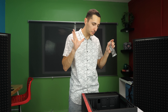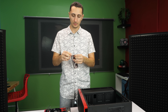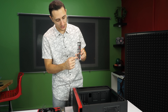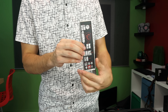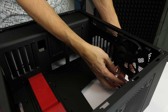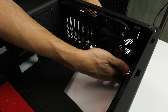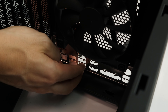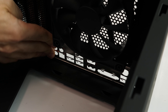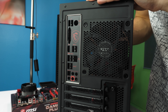Now the motherboard is ready to be placed inside the case, but before we do that we've got to pop in the I/O shield. Take it out of the motherboard box, peel it open, and make sure the circles are facing the downward position. Position the metal portion outwards from the inside. Apply pressure on all four corners evenly to snap it in place — this is actually the hardest part of building the PC. Once all four corners are pushed out, you know it's fully seated.